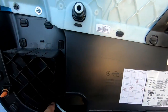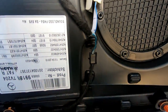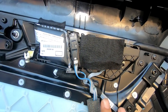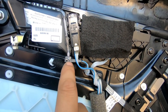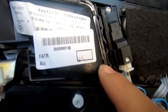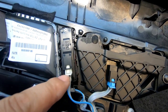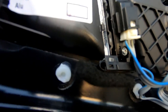From here, as you can see, this is your welcome door light. The cable runs along the bottom and then runs up here — it shares the power source for your boot release, and the main power runs along and splits into three different panels. One is for your lock and unlock, as well as your orange LED light that lights up your door handle. You have to disconnect this plug in order to remove it. If you wanted to remove your lock and unlock module, you just have to unplug this plug, push on this tab and unplug it — and then there are two Torx screws to undo.